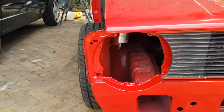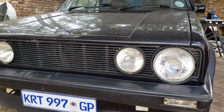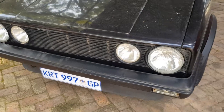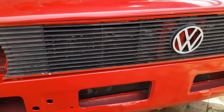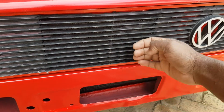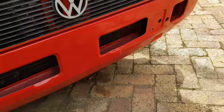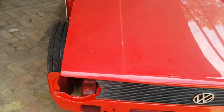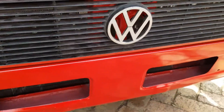So there were one of two things I could do on this car. Looking at the original cradle for the Mark 1, you can see there's a bit of a gap but it's not too bad. One option is to cut the cradle along the bottom, split it in half, move that portion up, and weld in a filler piece. Seeing as I don't have a TIG or MIG welder — only an arc welder — I didn't have that option, so eventually I came up with the idea of using fiberglass.